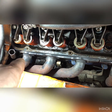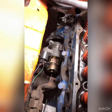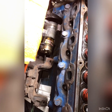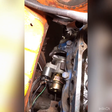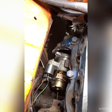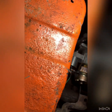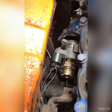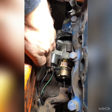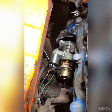So we'll go underneath the car and pull the exhaust off. We got the header out — it came out. We have to jack the motor up. You can see I got a board on it with the floor jack on there. The header's out and the starter's loose. So I'm going to go ahead and pull that starter up, take the bolts loose off the cylinder, get that starter out of here, get the other one in, and then we can start putting it all back together.